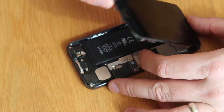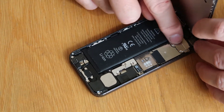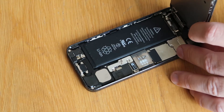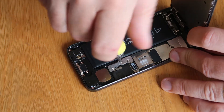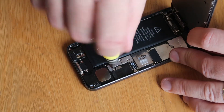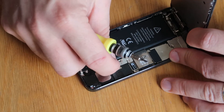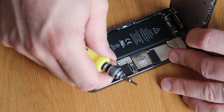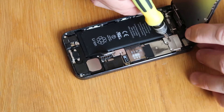We'll open this up. Now what we're interested in are these three screws here to release the screen, and we're going to do this here as well to get out the battery. So just grab a Phillips and we'll disconnect our battery first, as we always do. That way we won't cause any other damage to the phone when connecting LCDs and such — I've had it once before where the battery wasn't disconnected, the screen lit up because a message came in and blew the backlight. So always disconnect your battery.